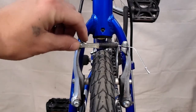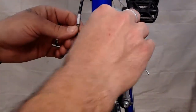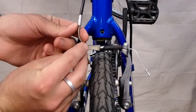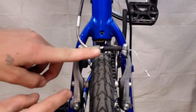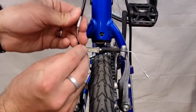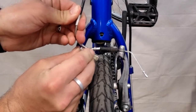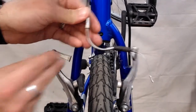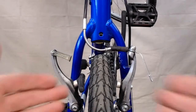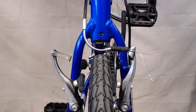You need to make sure you separate those. So if you pull back on the noodle this way while you push the stirrup or cradle that way, that's going to allow you to separate those just like so. That's going to spread your brake pads open, allowing your wheel to come out so your tire won't get caught on your brake pads.